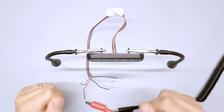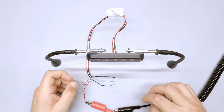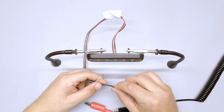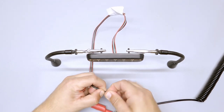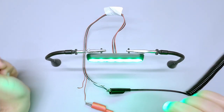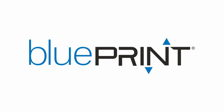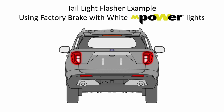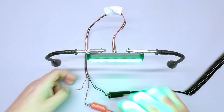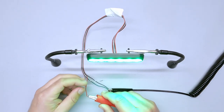The second function of the green wire is what we call drone mode or blueprint mode. It puts the light into a steady burn. Instead of tying the green wire to another light, we tie it to ground — and now we get a steady burn. This is made to work with external flashers, like Blueprint or a taillight flasher, allowing a specific flash sequence. It's instantly responsive to when power or ground is applied.